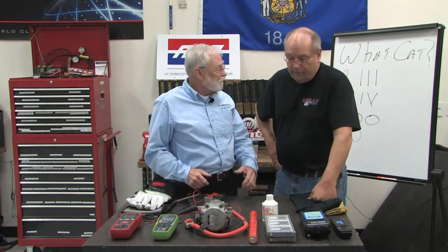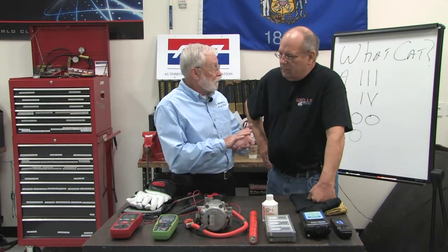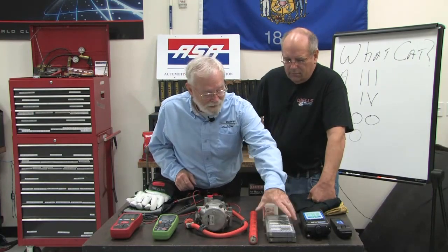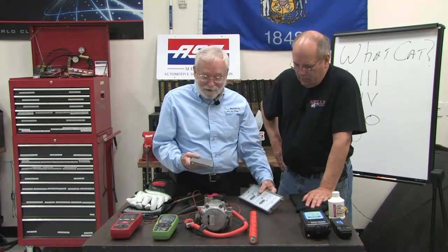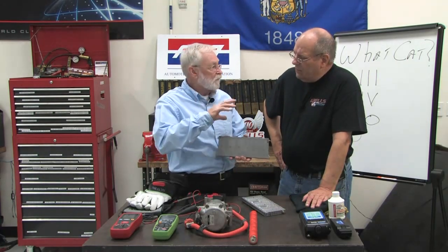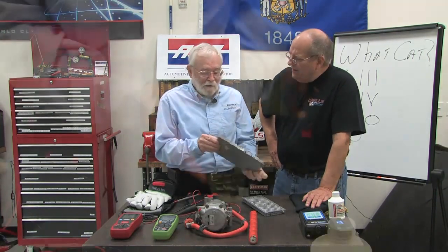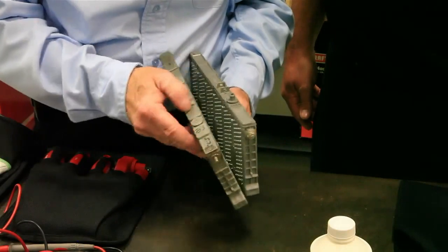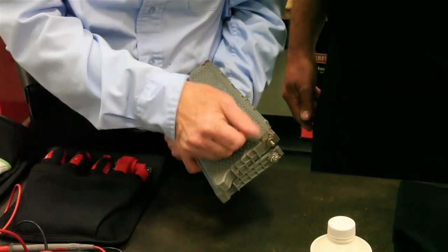Another thing that we find is sometimes that we get battery lights, for the high voltage battery codes. And I brought a couple of modules along, and that's what they call these. This is from a first generation Prius, the old 2000 to 2002. Yeah, and they were $5,000 battery ones. These were plastic, and you can see the damage here. They crack and they leak, and you can see it's been leaking a while. Yeah, and they can go bad.